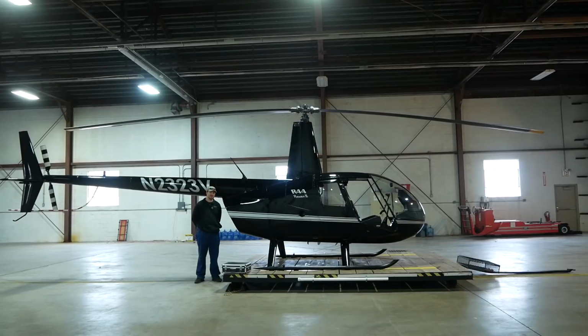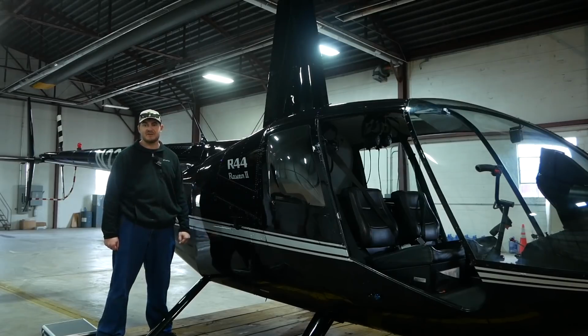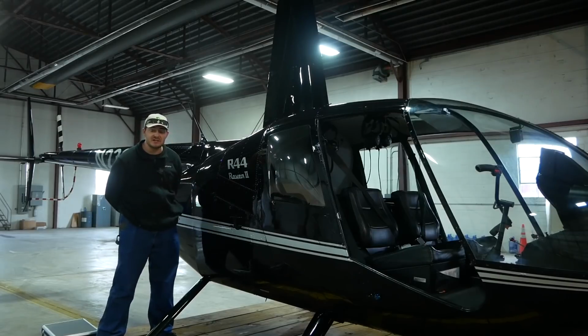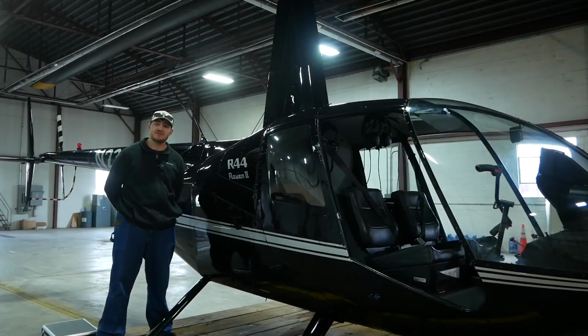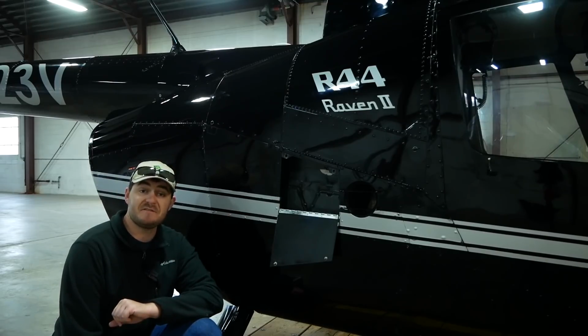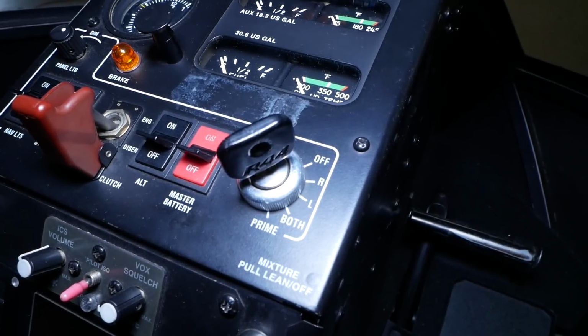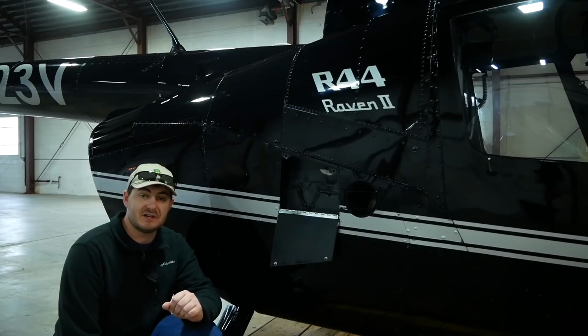It's a big engine. This rather large engine in here, tucked away underneath a very large air shroud, has mechanical fuel injection and no distributor because it has 2 magnetos. 2 magnetos for redundancy. Each cylinder in here has 2 spark plugs, 1 for each magneto, again for redundancy. On the key, you can select which magneto you want to have powered so you can check that each one is functioning. Or you can just run both of them.